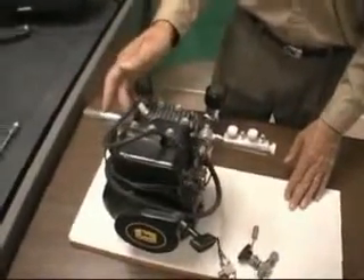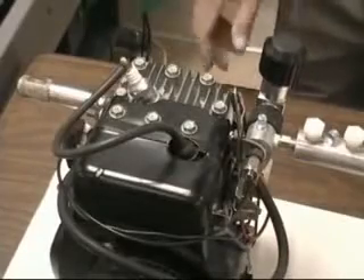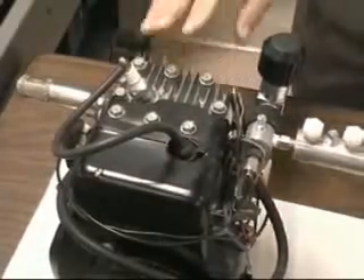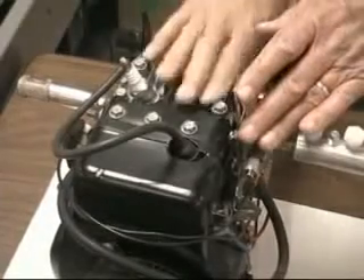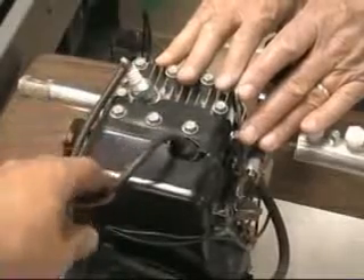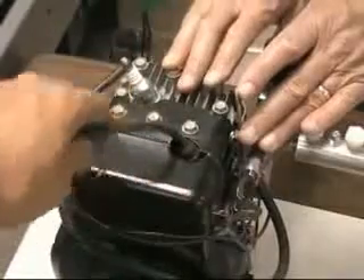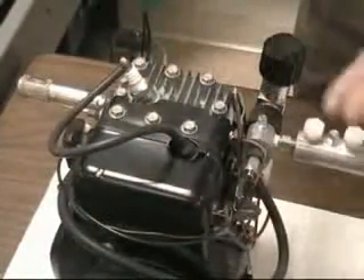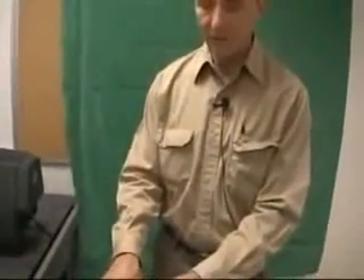You can do a delayed off for the flow of current to the coil and run this as a Kettering-type ignition with an external coil. Either way, you're going to have to change your timing on the engine if you want to take full advantage of the hydrogen — you'll time to a later point of ignition, pretty close to top dead center. Who makes the ignition delay? There are a number of companies; one such source is Autotronics — A-U-T-O-T-R-O-N-I-C-S — they're on the web, and there are others. You can also make one out of a Radio Shack 555 integrated circuit.